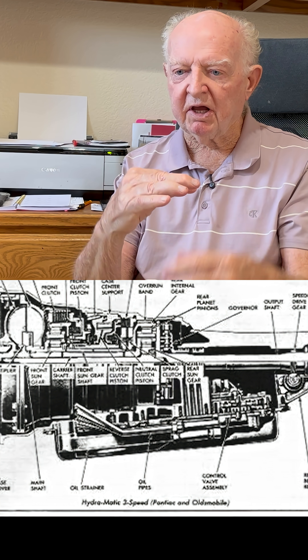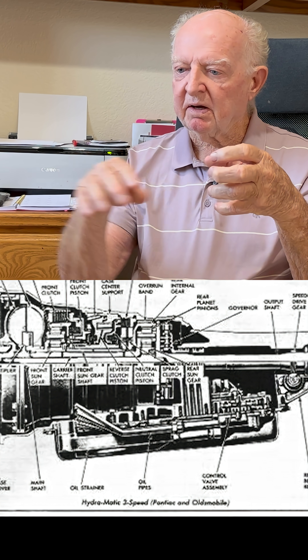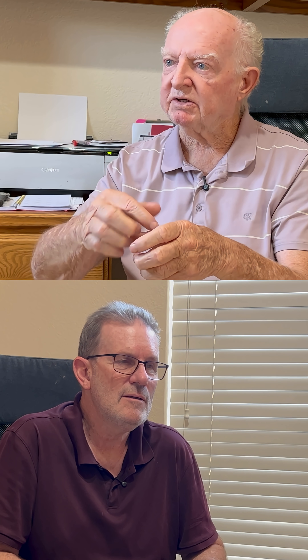One of them has a set of pipes — maybe about so many tubes all welded together. They went from the front of the pan to the back of the pan and bolted in with two mounts. All the fluid went through that thing instead of going through the case. Externally in the valve body were these four or five pipes — little tubes all hooked together in a manifold. They shoved in there and bolted up with a gasket, and that transferred the oil from the front pump to the rear pump and the governor assembly.